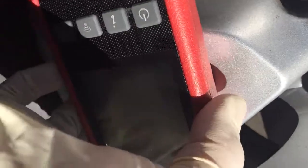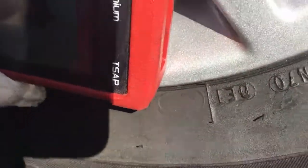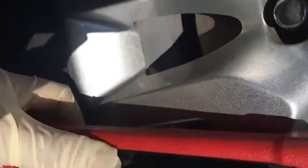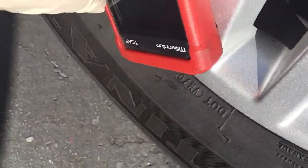This right front's not triggering. Let's see if we can't get this to trigger. I'm trying to get it right on this sensor, but it's kind of a weird box-shaped tool. I'm still not triggering. I could have a faulty sensor. The last person who put tires on this bad boy could have broken the sensor off on the tire machine — I've seen it happen time and time again. I've been guilty of it myself.